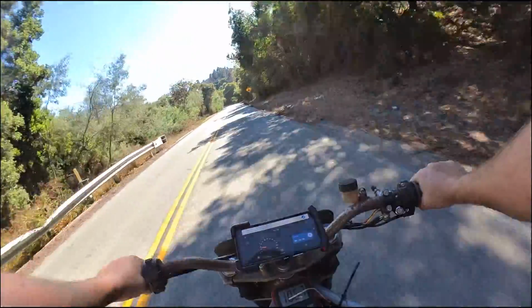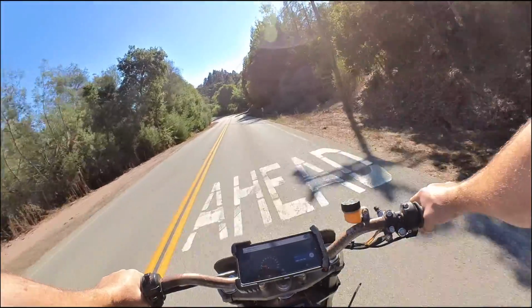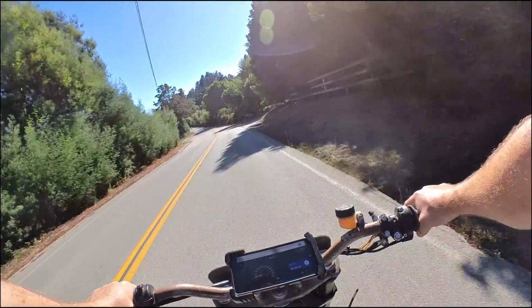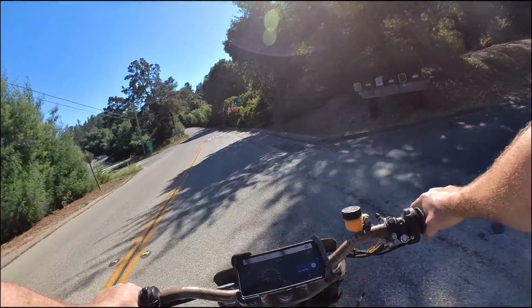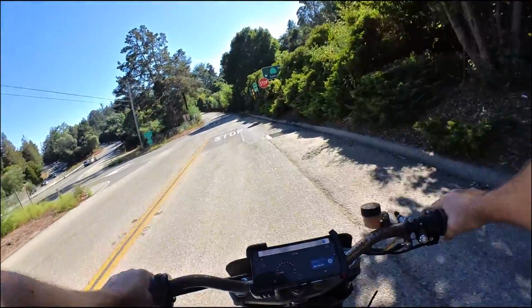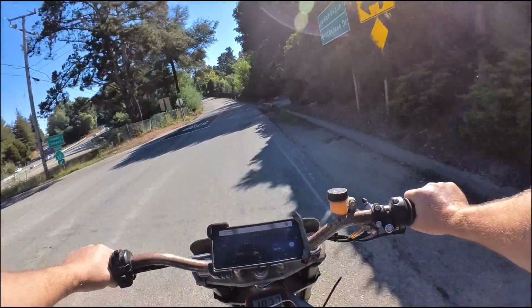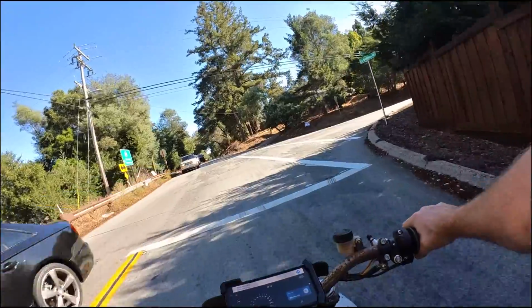One thing I don't like about this Kelly controller is it's speed or voltage based. So when you already have speed, you need to add more. You don't just give it a little bit of throttle, you gotta catch the throttle back up to the speed. So if you're already going fast, you gotta keep pushing the throttle farther, and there's nothing until there's something. Shit, come on.